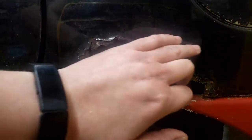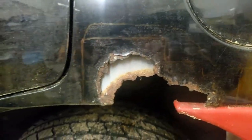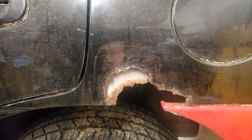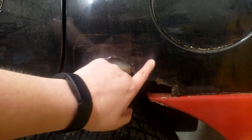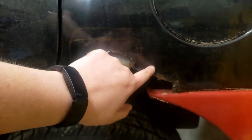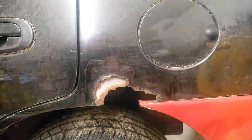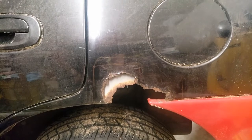We kind of marked up where we think we're going to cut — I think we're going to stair-step it rather than do this drunk type line that Alex drew. We're going to end up cutting this out and tack welding in some sheet metal, just to make sure we get all the rust. We did hammer around here and we're going this far out because the rust actually is under here as well, even though you can't see it yet. There's also some work on the body underside. This car was picked up with a forklift — stories for another day.